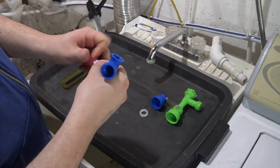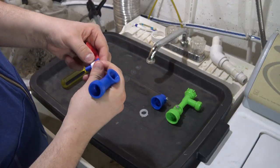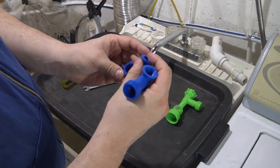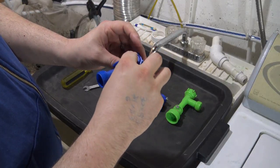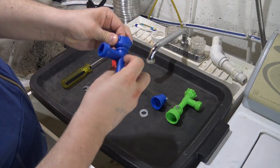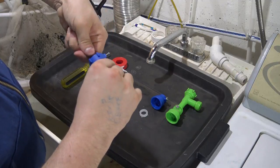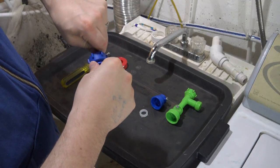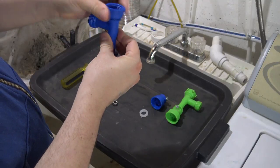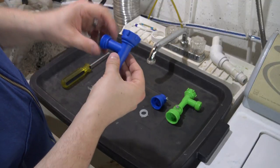And the easiest thing you can do to prevent leaks and to make sure this stays seated as best as possible is just to run one or two layers of Teflon tape around that fitting so that when you connect this, you drop the Venturi cone through your top collar, and then you can twist this on. And you need to make sure you don't cross-thread it. You might need help with a tool such as this to really tighten it on. But once you've done that and you've gotten it really tight, you'll see that this top part still jiggles, and that allows you to attach that tightly to your faucet. But it makes sure that you're not going to get leaking water between those two pieces.